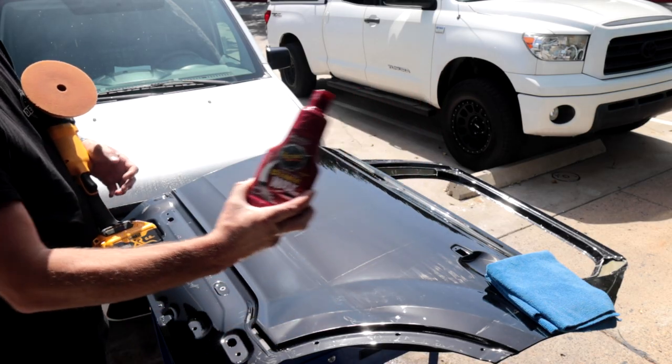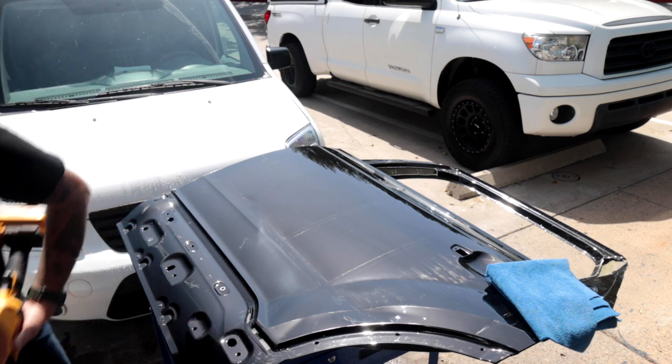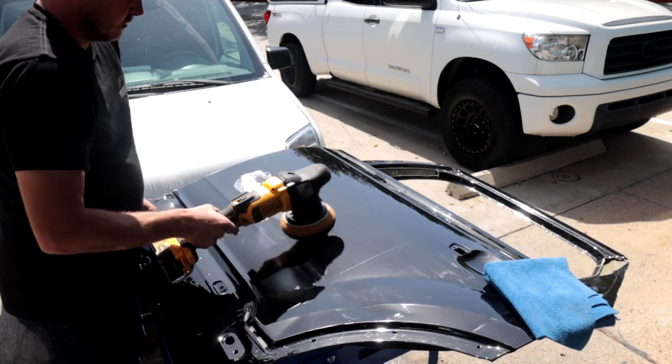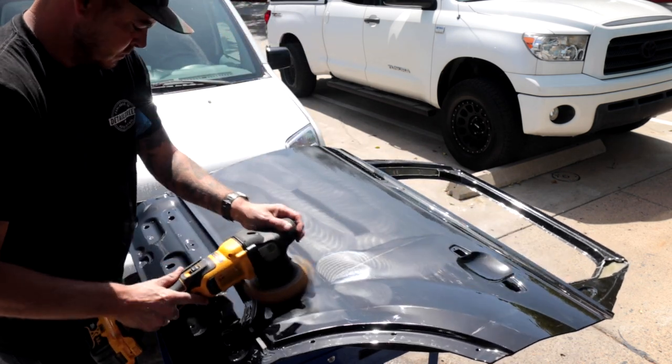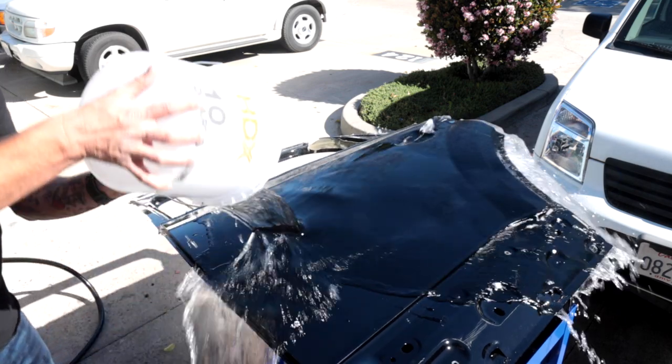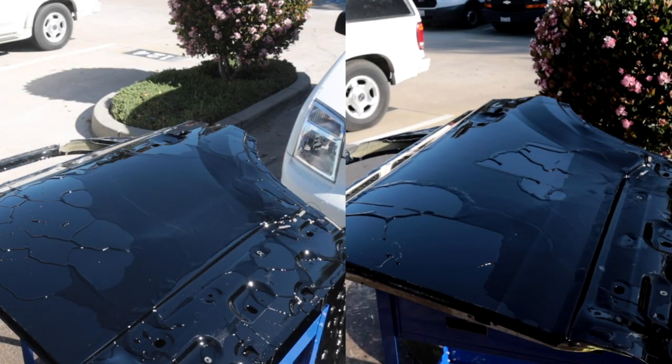About two days ago I applied a coat of Meguiar's Cleaner Wax over all three sections, giving it enough time to harden up. The cleaner wax has a slight cleaning effect, but not nearly enough to remove a ceramic coating, so no worries there. Now for test number two — with the whole panel waxed, I throw water on it again, and you can see a completely different reaction compared to when it was just ceramic. It's not because the ceramic is gone — it's because water is now reacting to that layer of wax on top.